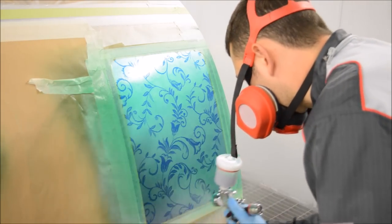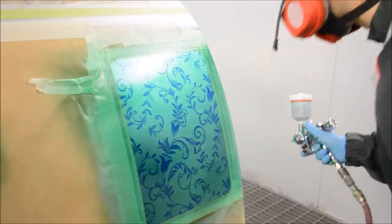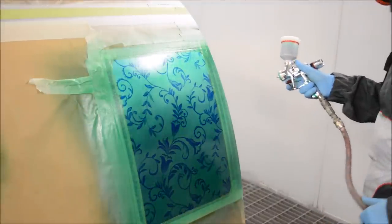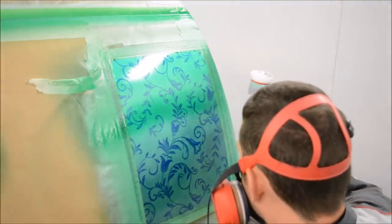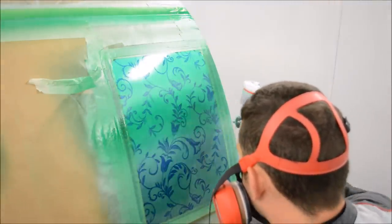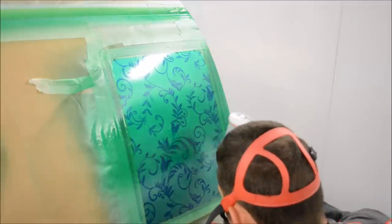Be careful not to put too much candy on though, because you're going to start getting horrible edge lines around this design, which is going to cause trouble when we come to clear coat and polish it later on. So I'm only going to put two coats of candy on, which gives us a really nice candy colour.